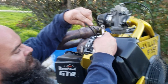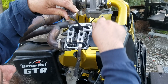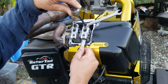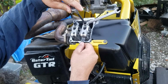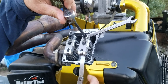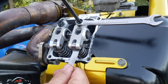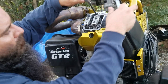Now I hold that still and I tighten my adjuster down. Before you get it tight, double check it again — I need to tighten it up just a hair more. You want a good roll on it, but you don't want it to put it in a bind. Snug it all the way down. Double check it. It feels beautiful — nice smooth roll on it.